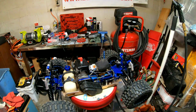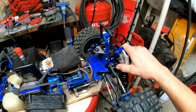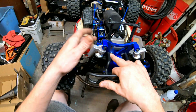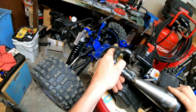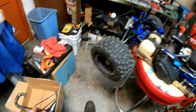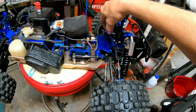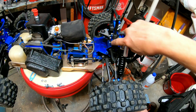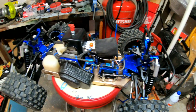But basically this bracket comes with it. Okay, I just put there that screws, these 2 screws come with it too, with the pipe. They're real long, so in order for me to get this bracket to where it lined up with this pipe the way I have it, it's kind of just sat on there, but as you can see, it lines up great there. So what I ended up having to do, I just put 2 extra nuts on there as a standoff to push this bracket out a little further, and then just put the 2 nuts on he gave me. So you will need 4, whatever you can use there to stand it out a little bit. Yours may even bolt right on, but mine didn't, and that's how I did it. Anyway, so let's get going.